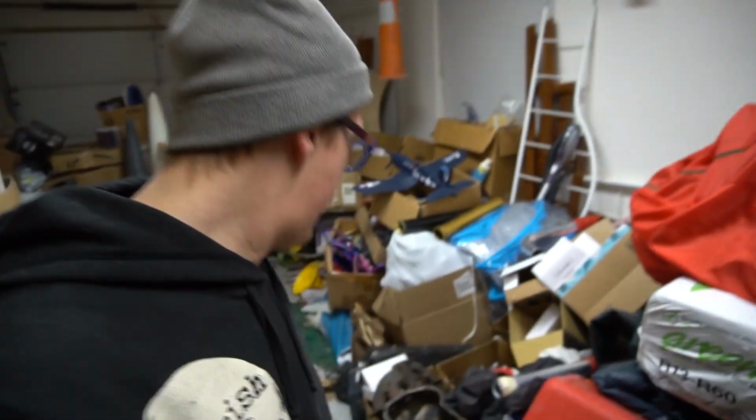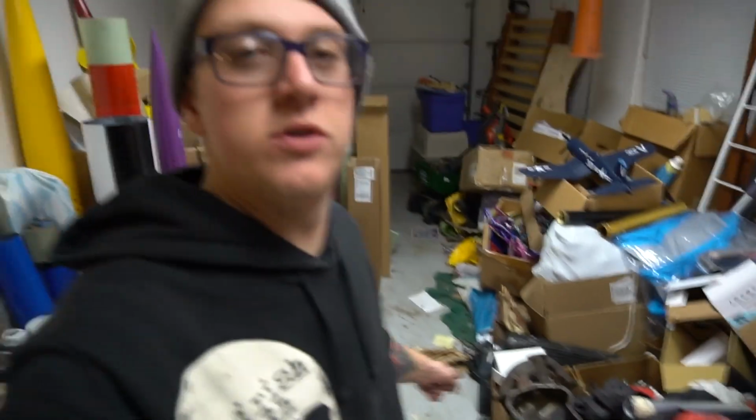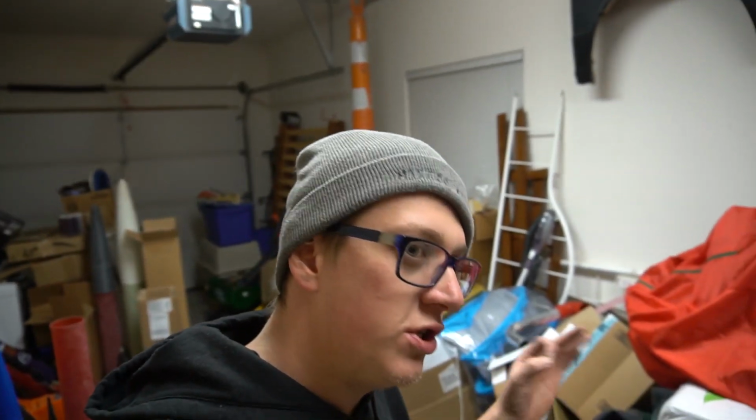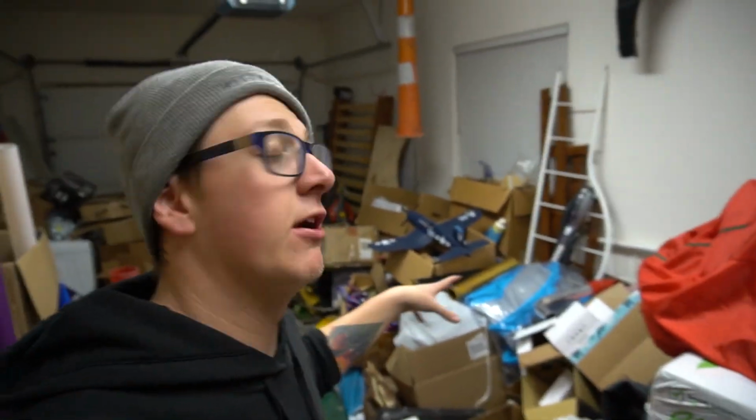But yeah, in recap here, we got T3 top mount turbo manifold, which is pretty sick. I like top mount manifolds a lot. 14B turbo off the original OG Rice Accord. All the parts, all the fittings, everything are off that Accord, which is pretty nuts. I'm going to get an oil sandwich plate to feed the turbo on this one, because I don't want to mess with trying to get the oil pressure sensor. And if you guys recall, on the Accord, I left it unplugged, and that's how I didn't know it was leaking a bunch of oil until it started knocking, and that's how the engine blew up. So I'm going to leave the oil pressure sensor alone. We'll do a sandwich plate, and I know it's unfiltered oil going into the turbo, but at the same time, does it really look like I care that much? I can tell you the answer is no.